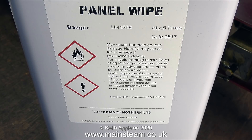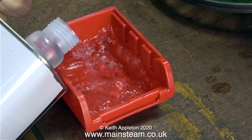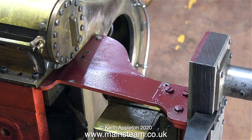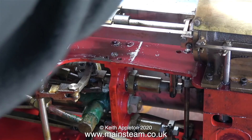I thought this was the stuff I've been putting in my Zippo cigarette lighter for years, although I no longer smoke. I poured some of this panel wipe into a suitable container and I'm going to use it for cleaning up the old paintwork. You can see how volatile this stuff is — in front of your very eyes it's evaporating. This part of the video is speeded up by a factor of two, but even in real time you can see it slowly evaporate.